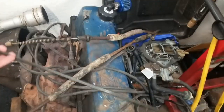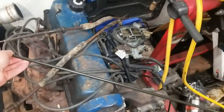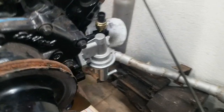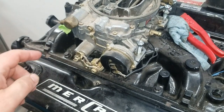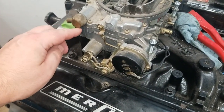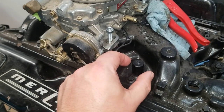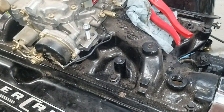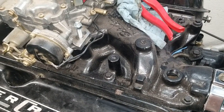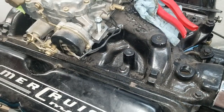Alright, well, I picked up a piece of 5/16 flared tubing. I'm gonna try to bend up a fuel line to go from here up around to here. I believe I got a Summit cart with a fuel line that'll replace this banjo fitting, come down underneath this with a spot for fuel pressure gauge, and then a 3/8 NPT fitting. It's probably going to interfere with my idea of going with the 60s Mustang heater hose routing.